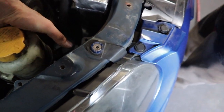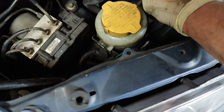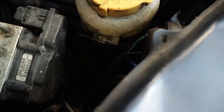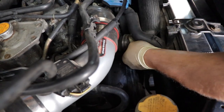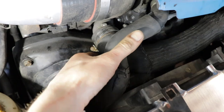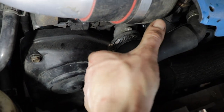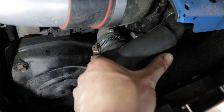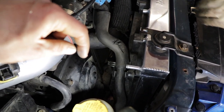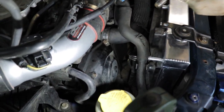Don't forget to put your power steering back if you've moved it. To get a little more room, there's a little tab you pull back and the bottle pops out. Always position your hose clamps in an easy-to-reach spot when reassembling — flip or rotate them so they're accessible. The bottom hose clamp was facing up toward the top and was hard to get to, so we'll switch that around so it's easier to reach from the top or bottom later.